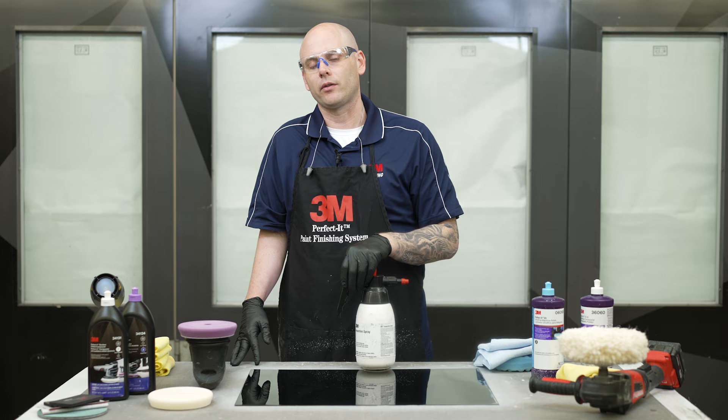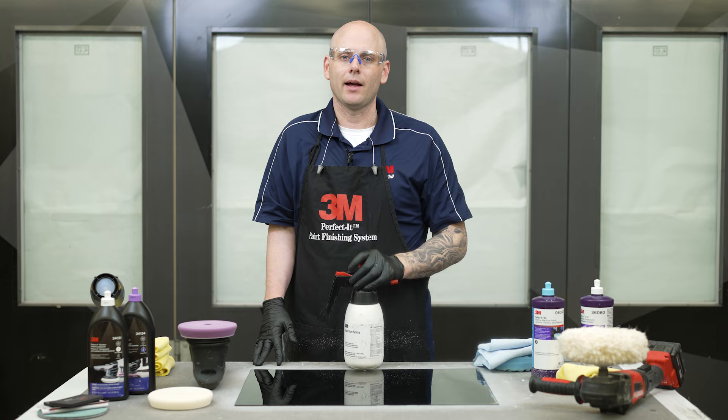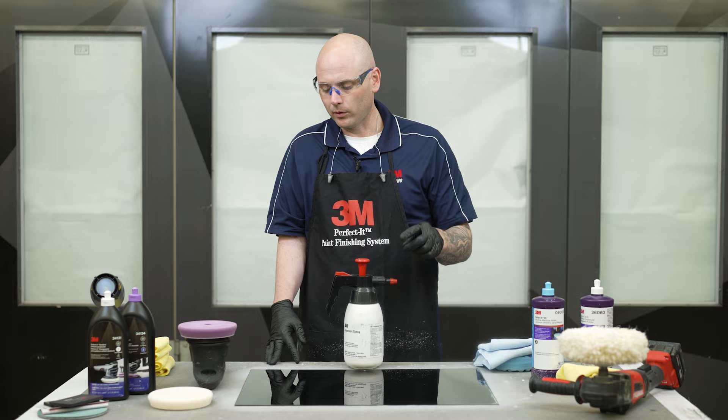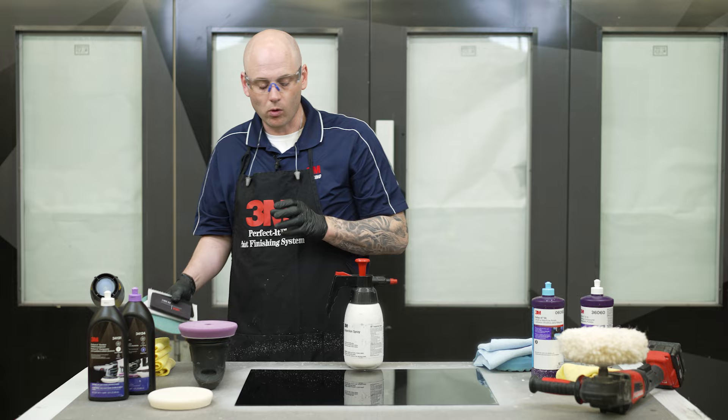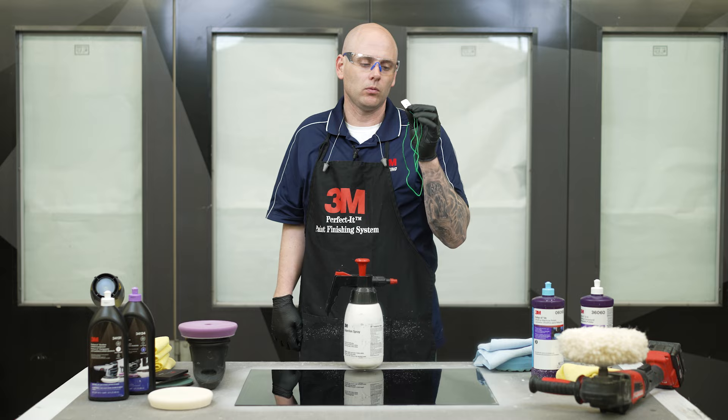Make sure you're using clean pads — if you have new pads and it's a straight black vehicle, that's the time to switch those out. Don't sand dirt nibs by hand with no block; make sure you're using some type of block, whether soft or firm. For any nibs, be sure to fully flatten those out with either a razor blade, a nib file, or a Festool blade. That's going to give you the best opportunity for success.